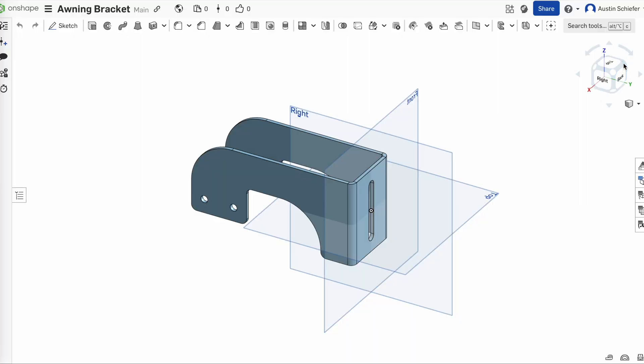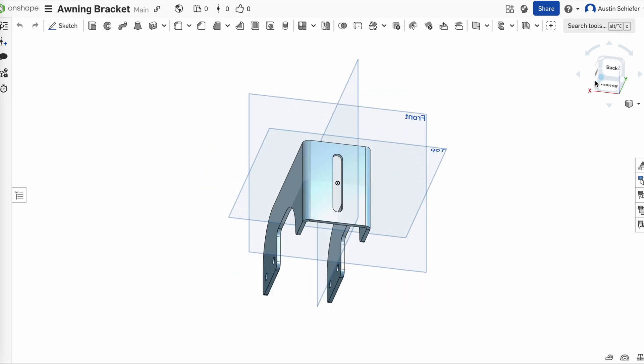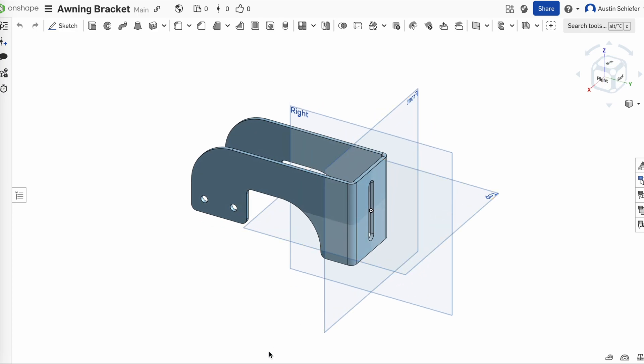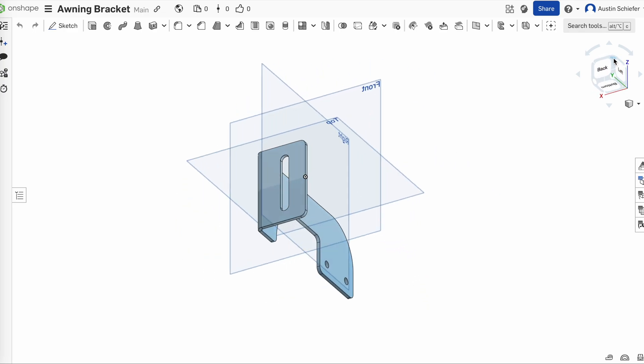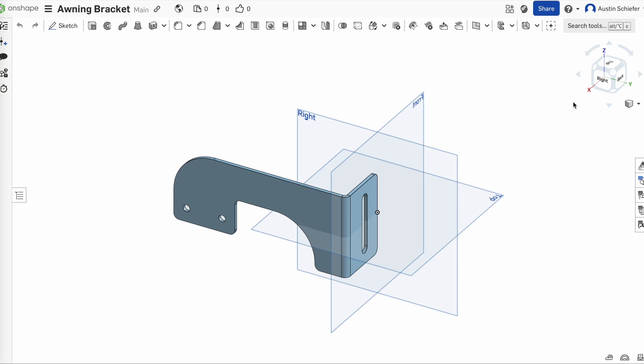This project started in Onshape — it is a web-based CAD program. It's pretty easy to learn with the help of the internet, and with my friend I learned it over the course of a couple of days. This is my cardboard template progression from bottom to top. As I iterated my designs, I made cardboard templates to test fit them onto my Lexus. And this is the final product. I had to split the bracket up into two separate pieces because SendCutSend was not able to do those two 90-degree bends with such a small face.